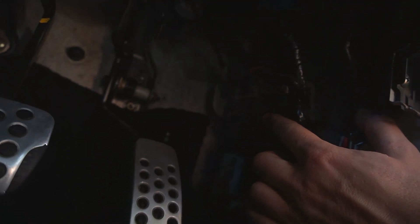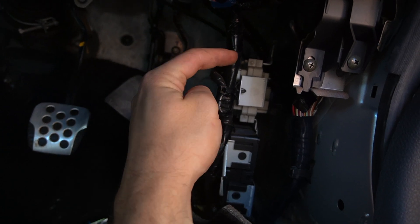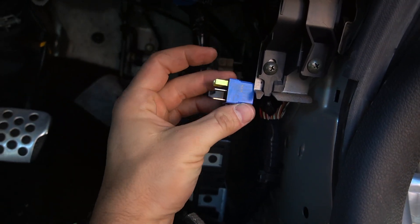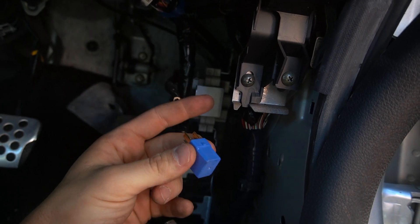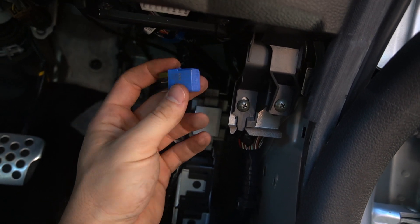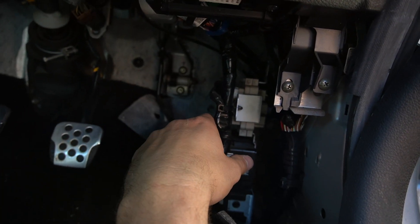It's a little bit dark in here, but what I'm led to believe is that behind the fuse panel in the footwell, there's two relays. So we're going to undo some 10mm bolts here and we should be able to get access to the relays. There's two 10mm bolts at the top, one 10mm down the bottom, and I've got access to behind the fuse panel — there's two relays in there. One closest to the door is apparently the one for the heater. What I'm going to do to test if this is the problem is switch that one with the other one. The other one's apparently responsible for the gauge lighting. So at least then we'll know whether this is the culprit or not — we can go and buy a new relay. I'm going to switch these over and then I'll film and actually test it out.